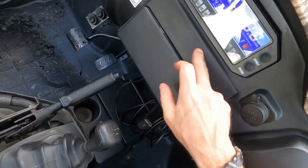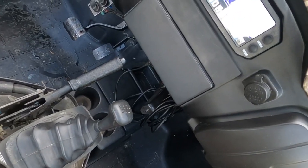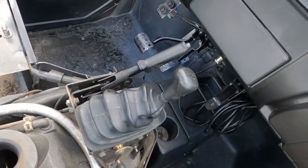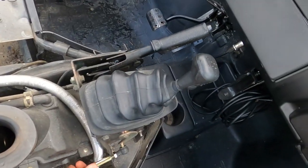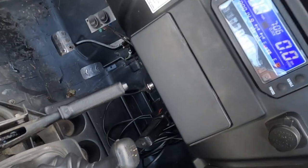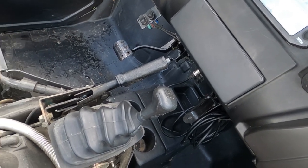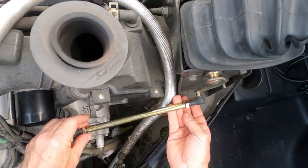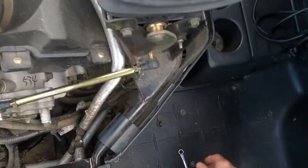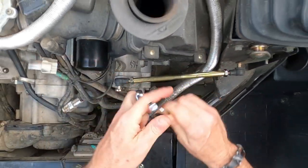You should be up in high gear, which it is — showing high gear lit up. What we're going to do is play around with this until we can get low gear to light up. We'll spin it clockwise — see what that does. All the way in, now we'll come back counterclockwise. See there, now it's showing high gear. When you spin it back, it goes out. Just go back two or three turns until the high gear indicator lights up, then lock it down right there.